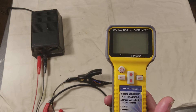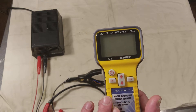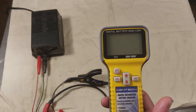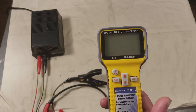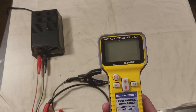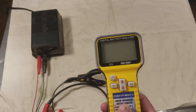The nature of 12-volt batteries is that if you just freshly charged one and then put this on, it'll say it's okay — because this isn't a load tester. This isn't actually going to plug into anything or run a starter motor to really determine how quickly it's discharging or how much the voltage drop is.